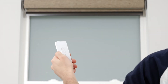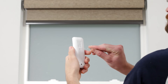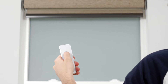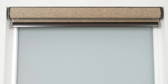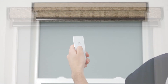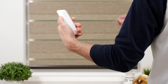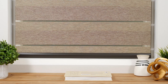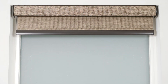To save a new upper limit, use the up and down buttons to position the shade about six inches below the desired upper limit. Then press the program button on the back of the remote. The shade will jog up and down to let you know it's in limit setting mode. Tap the up button to move the shade incrementally until reaching your new limit. Press the program button on the back of the remote again until the shade jogs — your new upper limit is now programmed. To set a new bottom limit, position the shade about six inches above the desired lower limit. Press the program button on the back of your remote until the shade jogs, then tap the down button repeatedly until the shade is set at the new bottom position. Press the program button again and the shade will jog to confirm that the lower limit is saved. With the factory reset complete, test to make sure your shade operates and reaches each limit as expected.